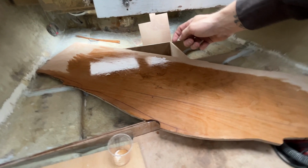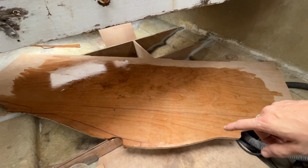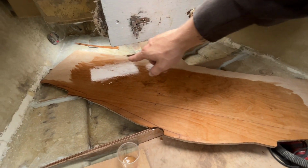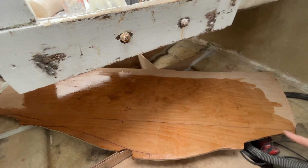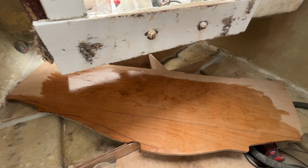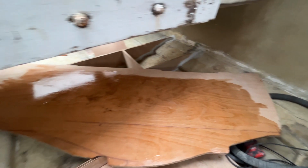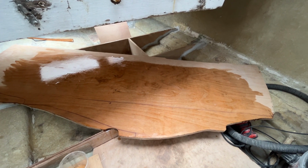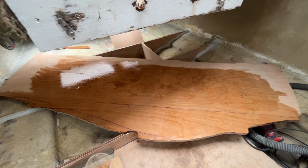Right, and that's that side resin washed, and this side I had a bit extra, so I went up, but I left the gap where I'm going to fiberglass it in, because I was always going to resin wash this anyway. Same with everything I do, floor, all the walls, and then carpet would go on top of that. So I just left that so I didn't have to sand that down again, so that should bond the fiberglass quite nice. So I'll let that set off for a little while now, and then work out how to do the bonding, and then I'll give it an update.